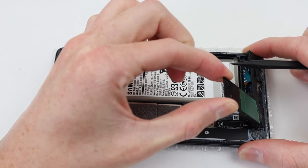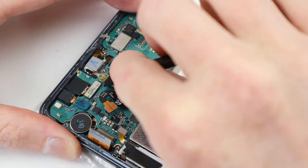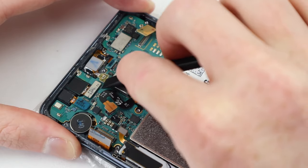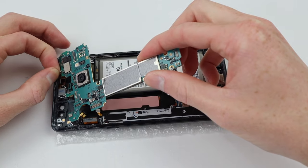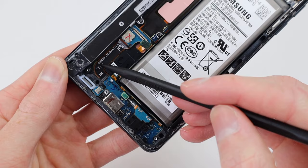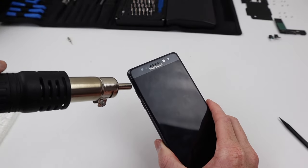So there's some other issue with this phone. With the Galaxy S8 and later, the wireless charging coil must be connected for the device to charge, or it will show a low temperature warning — but this isn't the case for the Galaxy S7, Note 7, and earlier. As this phone is a Note 7 at heart, it doesn't require the wireless charging coil attached to charge. With the motherboard removed again, looking at the charging port, the model number is N930F — the Note 7 International. I believe the charging port is responsible for the low temperature warning.